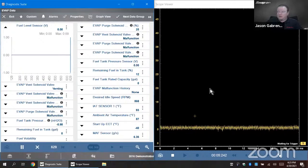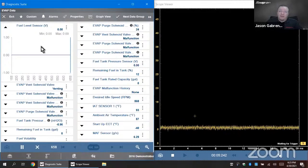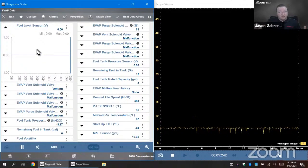Right. So I can see what's going on at the sensor, and I can see what's going on at the computer, and they do not match. If I see voltage here and this is good, and I don't see voltage here at the computer, the break is somewhere in between, right? It's not making it all the way back, but I know the component's doing what it's supposed to do, because let's say that 5 volts is good for whatever condition we're in. So this is good, that is not.